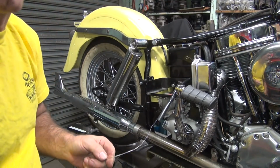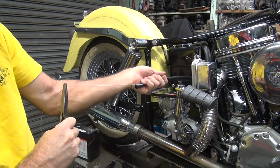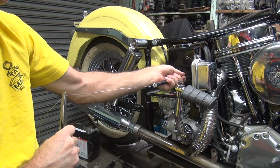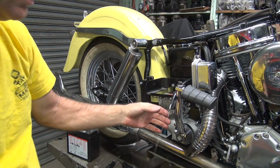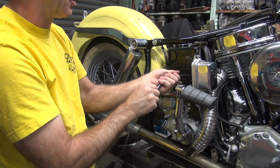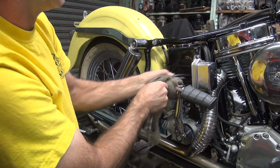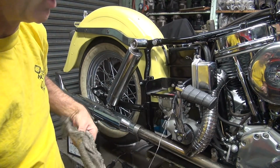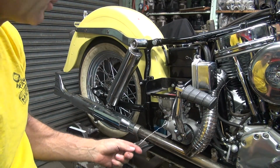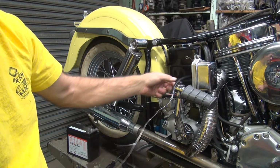So we're going to take our pliers right here, hold the pliers and pull. Look at that. Right on down. Okay, come back up a little bit to hold it. And now we've got a little extra protection on our cable. Now if you use that split corrugation stuff, it can split and be a problem down the road. It just opens up and falls out. When you have a solid piece of conduit, it doesn't fall out.